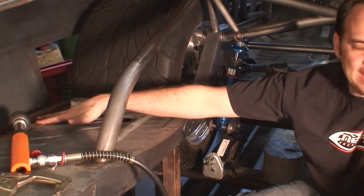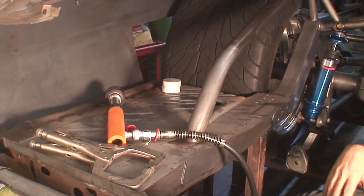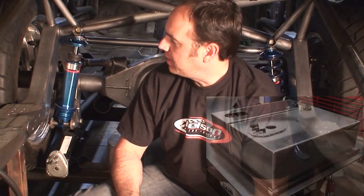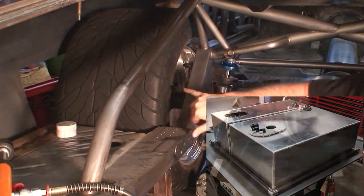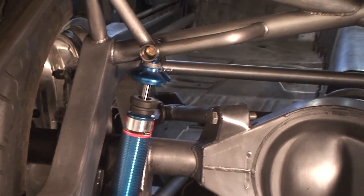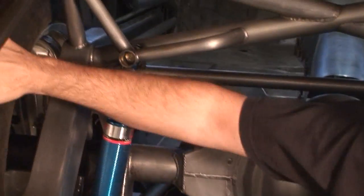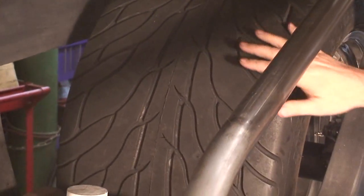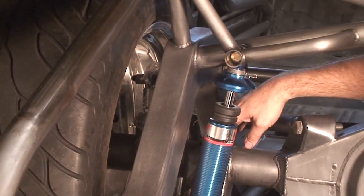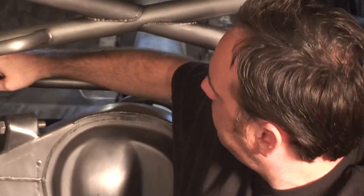At the back half of the car we've cut out the floors to make all new ones. Since we widened the fenders, we've got to extend the rear pieces, and we've made custom fuel tanks to fit in this area — all handmade, with fuel pumps and filters inside. We made all new frame rails, caged everything, double-sheared the coilovers, water-jetted all the brackets, and custom-built the entire rear suspension to accommodate the bigger tire. The axle sat basically right against the frame rail, so we had to raise it to have suspension travel.